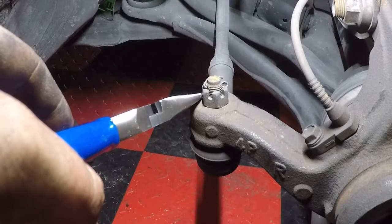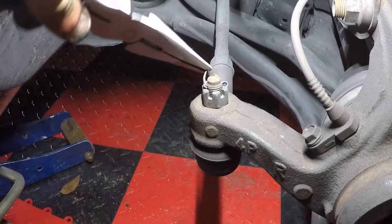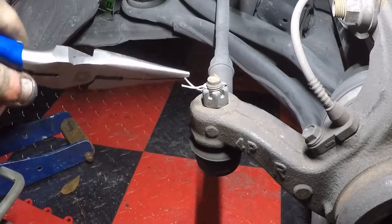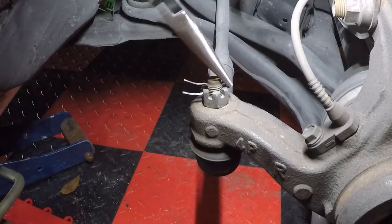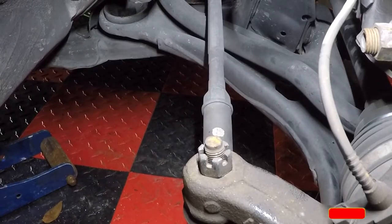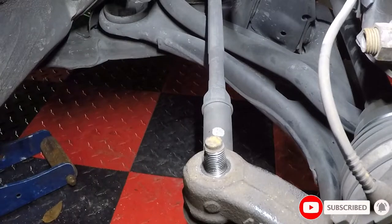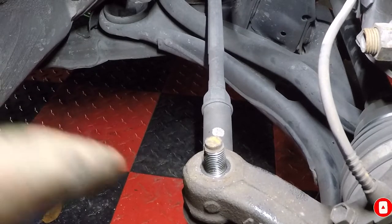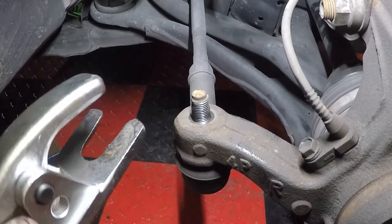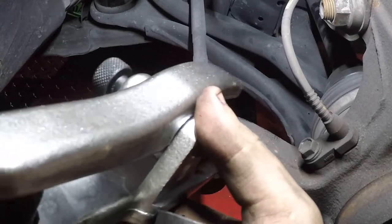So what we're gonna do now is we're gonna disconnect our tie rod end here. So this is usually a little clip. Just gotta bend it back out with some pliers. And you should just be able to pull it right through. So this one's 11/16, and then we're gonna come back and use the ball joint separator, separate that. So we're gonna take my new favorite tool here and just gonna loosen it up a little bit,